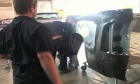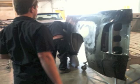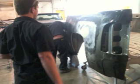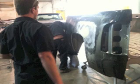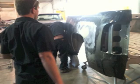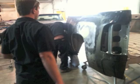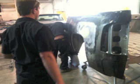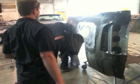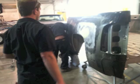Now we're starting to fit the bedside on and get it aligned so that we can start welding it. Now there's a couple of ways that you can do this. One is you can use a MIG weld and plug welds with a combination of adhesives, like it was the top rail, and a lot of those areas you can use adhesives. Or you can also use a combination of plug welds and spot welds, and we're going to use our spot welder so that the students can get familiar with it, and we'll show you how to use that in the next photo.